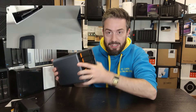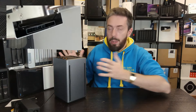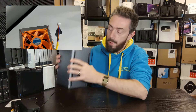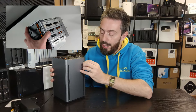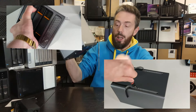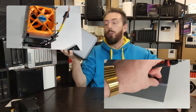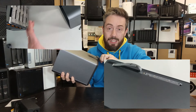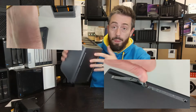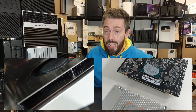Getting inside this to upgrade the memory and change the SSD in a modern 2024 NAS was a nightmare. You can't just access it from the base or the rear — you have to peel off the entire rubber feet, which when you peel them off is not only hideous but they barely stick back on. You have to remove all those screws, take the system apart into three pieces, and remove the PCB just to access the NVMe and the SODIMM memory upgrade slot. It is a horrible way to get inside this device.